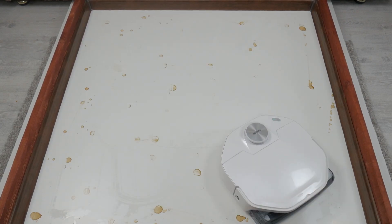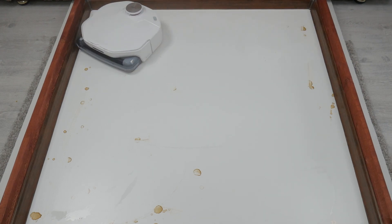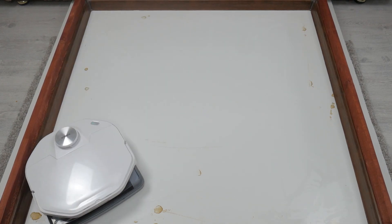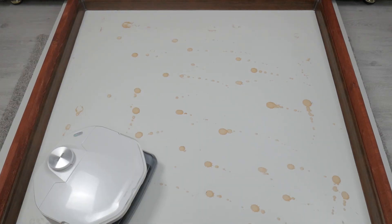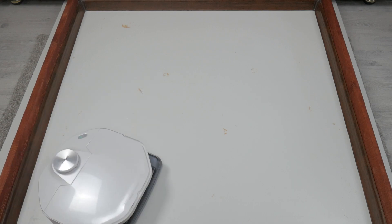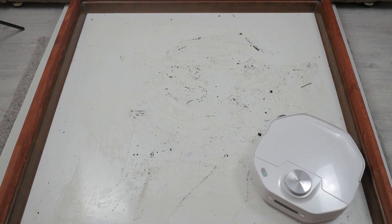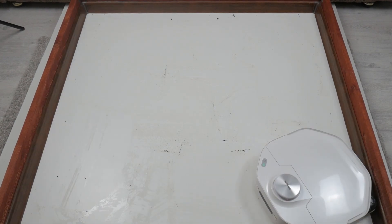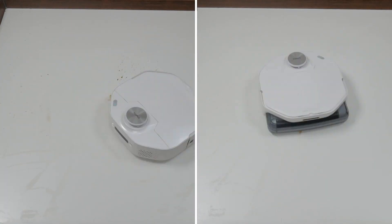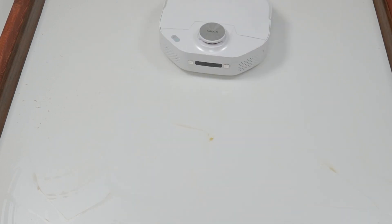The main function of the SmartMe is wet cleaning. Dried coffee didn't give the cleaner much trouble — within 2 minutes the roller got wet and started cleaning the stains, and it took 4 passes to complete the task. SmartMe effectively cleaned the middle of the area, but within 5–7 cm of the walls, stains remained due to the gap between the roller and the edge of the casing. Starting the juice test with a pre-soaked roller made the SmartMe more effective — in 4 passes the whole area was cleaned, with better results even along the walls, though some stains remained in various spots. During the soil test, SmartMe picked up clumps of earth and immediately cleaned the floor — 4 passes were enough. Unlike robotic floor cleaners, SmartMe doesn't leave streaks even when dealing with extreme dirt. Spilled liquids were no problem either: coffee and tomato juice were removed in 2 passes. The broken egg required 2 more passes with intermediate washing of the roller, but the final result was good — not even a shell remained.